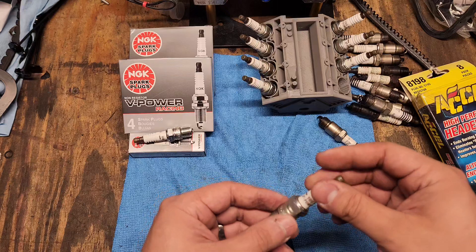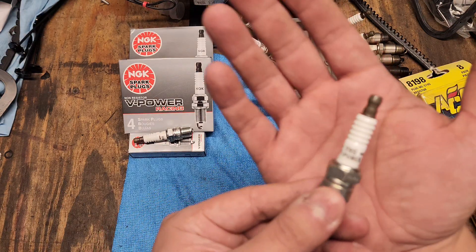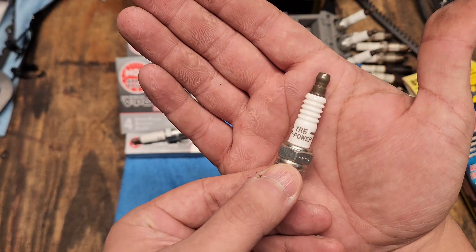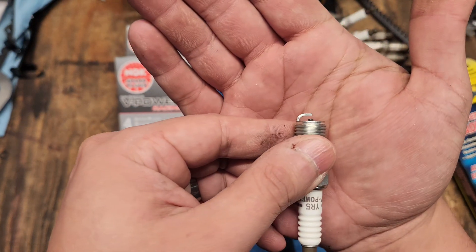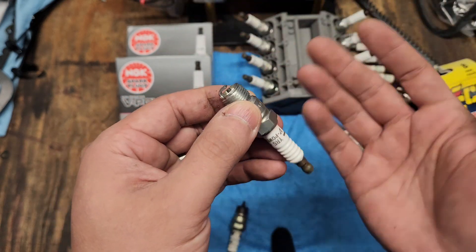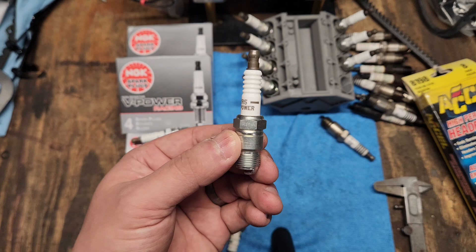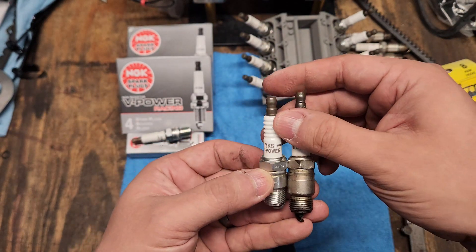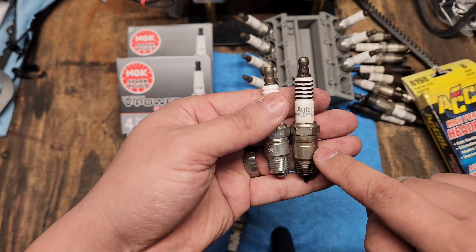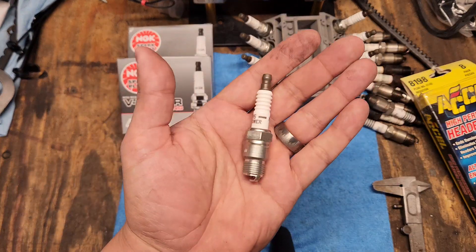If you're running long tubes and want something you can find at the parts store, the NGK YR5 is the answer. If you need a non-protruding nose, that's the YR5. If you're okay with a protruding nose, that's the UR5. Either way, these are shorter than stock — you can tell just by looking at the case, the front section is much longer on the stock plug. This might just be the ticket for what you're trying to do.